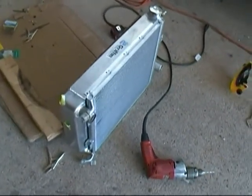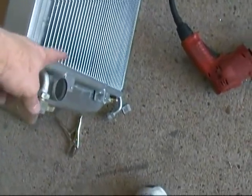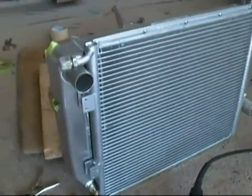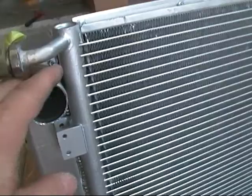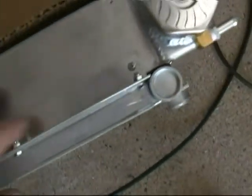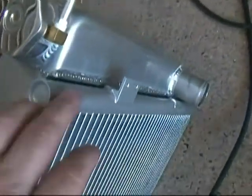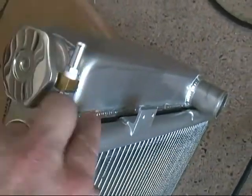It took a lot of creative thinking to figure out how to put a condenser on the back side of the radiator when you have the feed tubes, because these little outlets are in the same place. I did a lot of searching on the internet and came up with this device here — it gives me plenty of room and fits just exactly inside. I've got it sealed to the front and this one comes down here. I had to modify the drain plug a little bit, but it fits on here really nicely. I've got a piece of angle that holds it across the top. By the way, this is a two-core radiator from Griffin — more than double what I had. I had to 90-degree this because it came straight out, and I cut a bracket off so it'll clear everything. On the bottom I put a little piece of aluminum channel all the way across to bolt these two pieces together and keep everything straight.